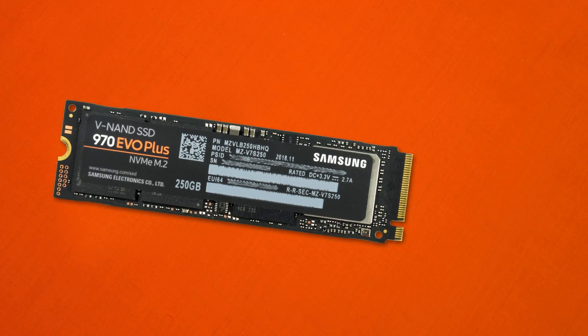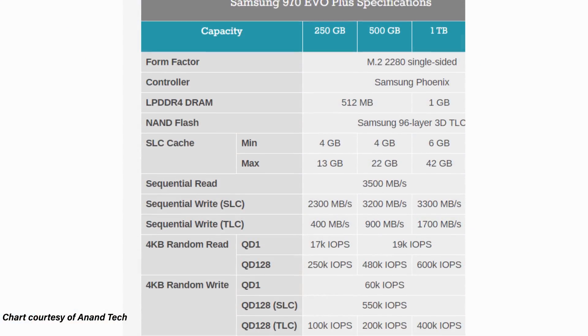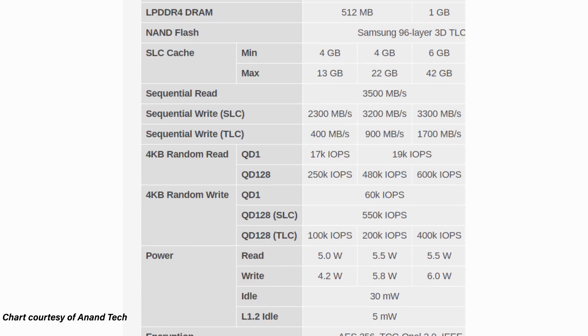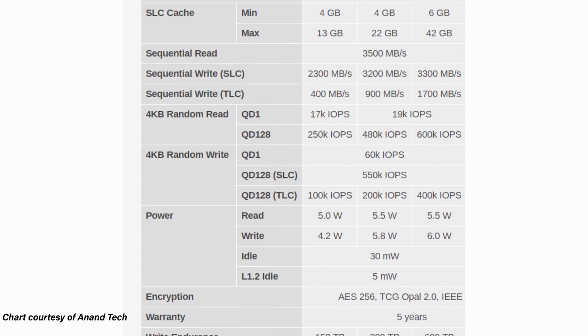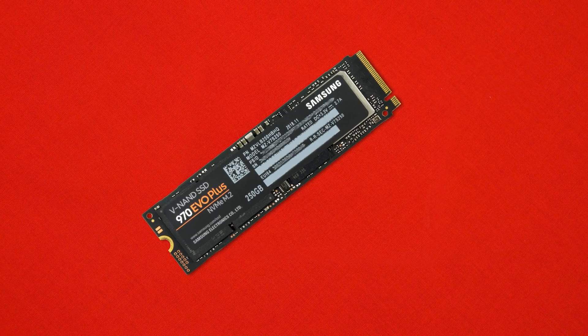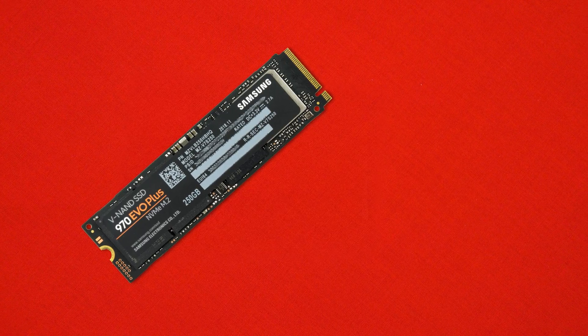The paper specs are interesting because this SSD features both SLC flash and TLC flash. Most SSDs use one type — generally MLC or TLC — whereas this drive has both. SLC handles super-fast instant drive access, while TLC provides larger mass storage. The SLC acts as a fast cache that data gets written to first, then migrated to TLC. This is all managed on the SSD itself with no user intervention required, and it's a feature worth appreciating.